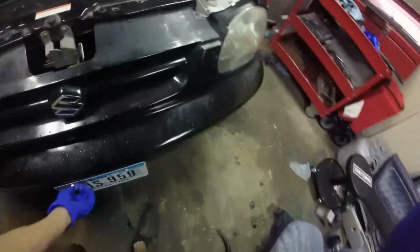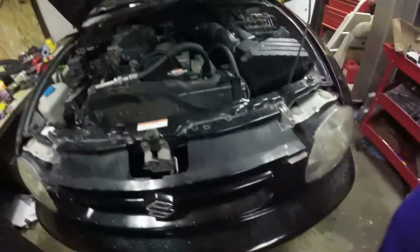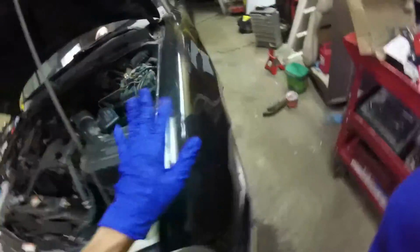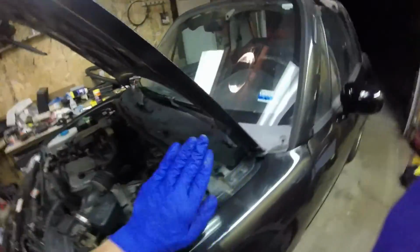The brakes are functional. But it's not done. The brakes, I'm getting a lot of pedal wobble when I get on it, especially at high speeds. So it's like I get on the brakes and it starts kicking back. So I've either got warped rotors or really low pads on one part or something. I'll have to check it out there.